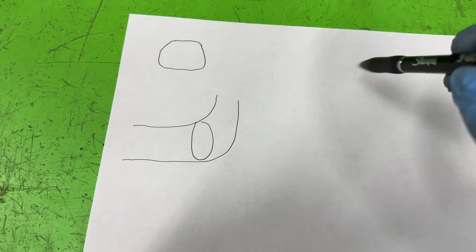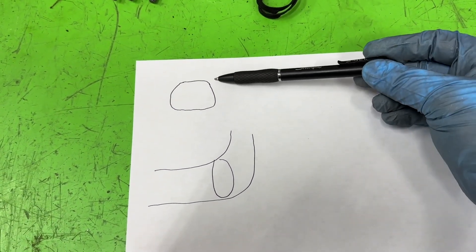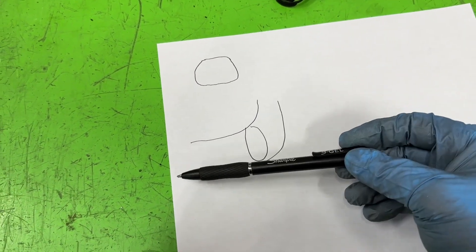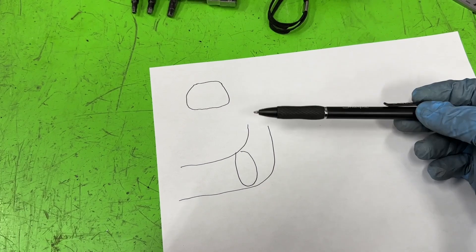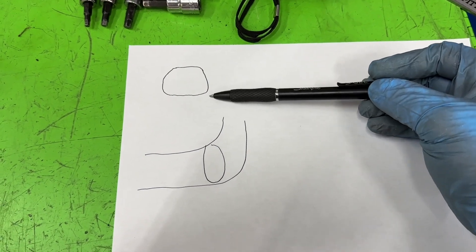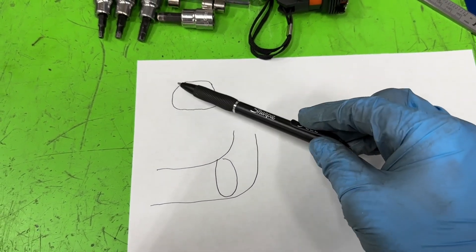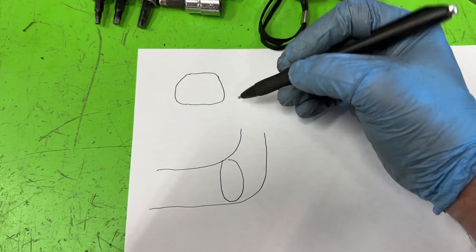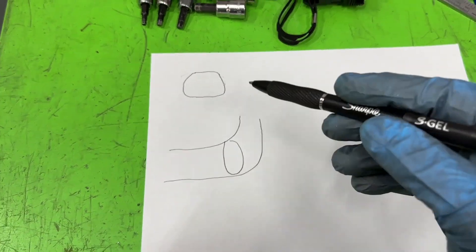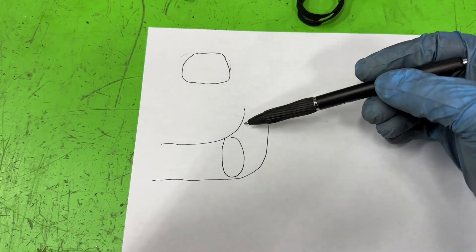What I did here is I did a drawing so you can see where we're working today. I'm going to be in the port room and I'll show you, but I don't know how well I'll be able to capture this on camera, so bear with me. When we got done doing the bowls in the last video, the head's sitting this way — you could think of the valves actually facing up, towards the sky. This would be the entry of the port, and you can see the bulges on the bottom, which is actually the top part of the port. What we're essentially going to do today is smooth these up a little bit and start working the short side. This is the beginning of the hardest part of porting — the bowl part is pretty easy, but this part is hard, especially shaping the short side.